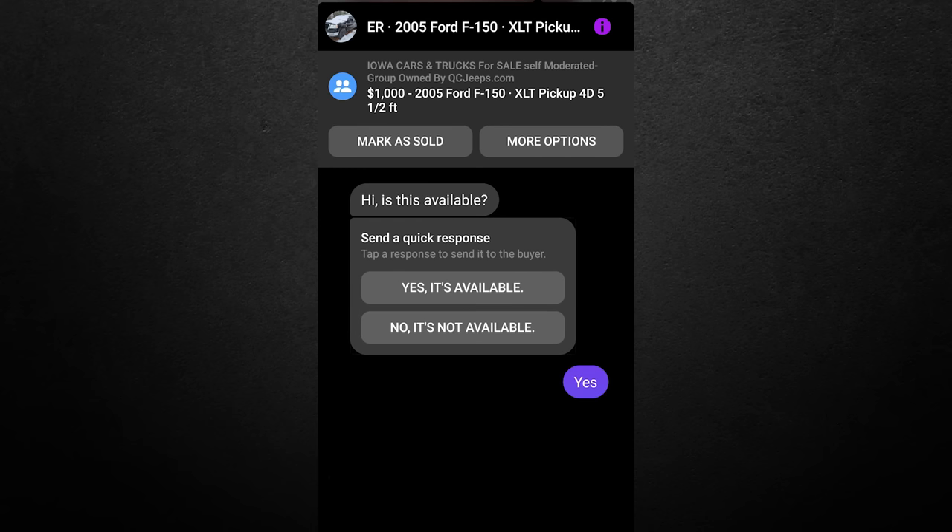Look at it in here — you've got a big buckle right there. It buckled on the bottom down here, finally. We actually folded the whole frame over a little bit. That rust down there is no longer aligned. We've got a big sway from getting hit under here. This used to be over here and now it's back. This door — I can stick my hand in. This door doesn't close. We've got some pinches right there. The whole front is up a little more than it used to be. That's from hitting the tree. Took that tow hook right off. They must not have been very good tow hooks to start with.